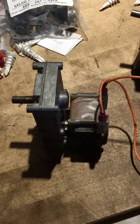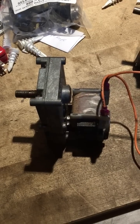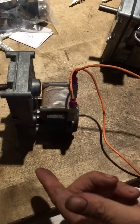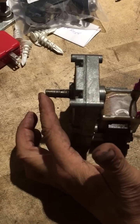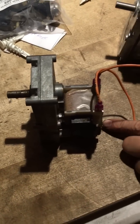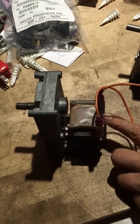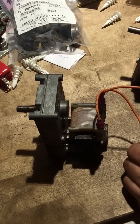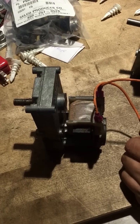Sometimes it's not always obvious if the auger motor isn't performing correctly — sometimes it is. I have seen auger motors where the coil windings will short out, they stop, the gears break in the gearbox and the shaft will stop turning even though the back motor shaft still turns. Sometimes the laminations break down on the coil windings, they short out or they just get weak and they can't turn and feed the pellets properly, and you may get a lot more jamming.